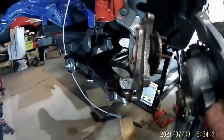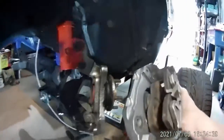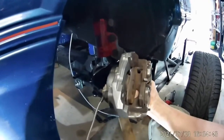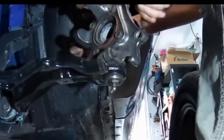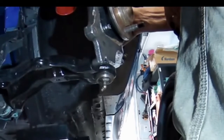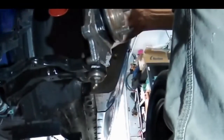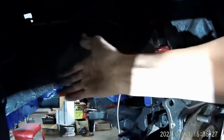Many years ago I was able to score the K-frame and control arm from a Shadow, and that allowed me to get the big brake setup. One of the things that I found right here, when this hub turns, the spindle contacts the steering stop. And unfortunately with the Laser, your tire hits the fender. The tire actually contacts this area because the wheel has been pushed forward with these control arms. So that pushes your tire up into this area instead of into this area. Preferably you wanted your tire here, but with the new geometry it becomes here.